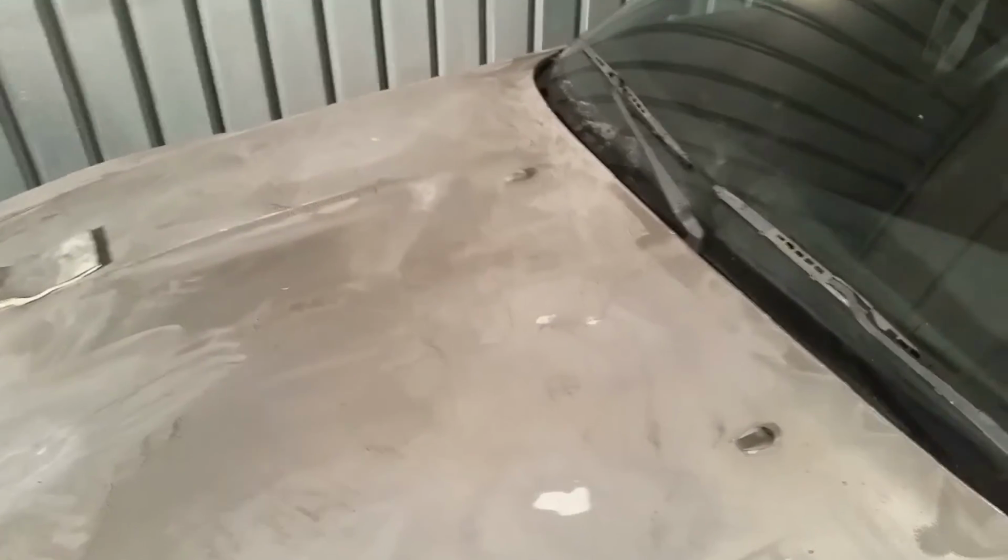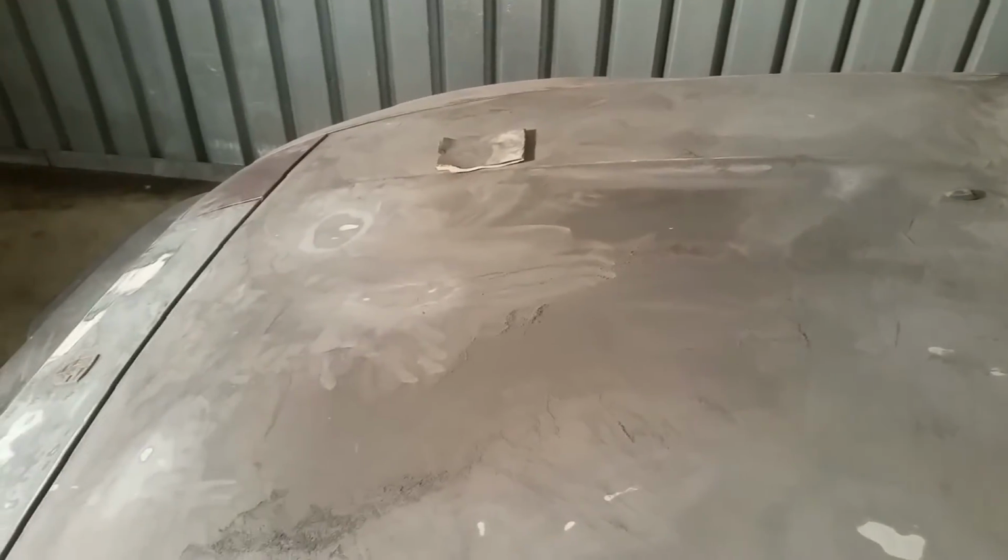Okay, so where are we at? We're sanding some of the parts down where the clear coat has come off and getting down to the base coat. You can see these parts here that I'm sanding down in the process. There were some dents in some areas, so I went ahead and filled it with a little Bondo here. I'm going to sand it down. If we move over to here, this is me after I put some fiberglass in to fill it in. Now I'm shaving it back down.